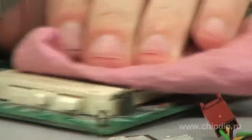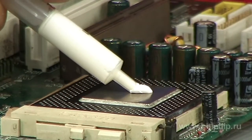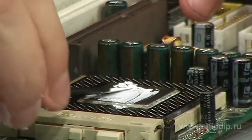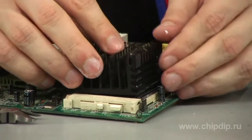In the beginning, it's necessary to degrease the surfaces. In our case, there is a processor with a broken fastening and the surface of the radiator cooler. Place a plain layer of glue on the surface, using no more than 0.1 mm per 1 cm², then fix the surfaces together under pressure for 15 minutes.